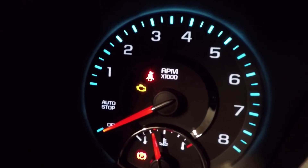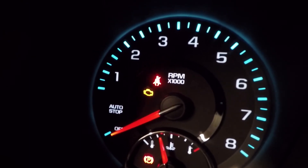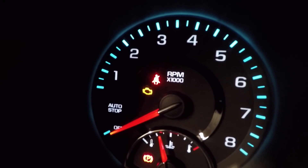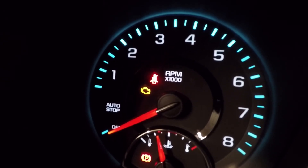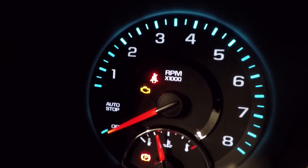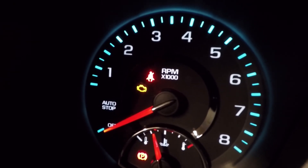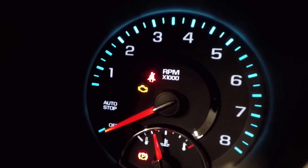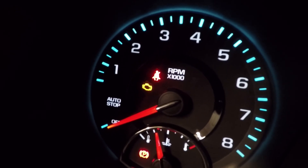If you have an engine light on, here's a way you may still get your vehicle to pass depending on what code you have. Clear the engine light — that, as we saw, is going to reset all of our readiness states. But then go through your drive cycles, and as long as you can get the computer to test the different parameters without that engine light coming on — because it may actually take longer to come on than the readiness states to complete — you may still pass. I would give that a shot if your check engine light isn't coming on right away after you clear the DTC code.